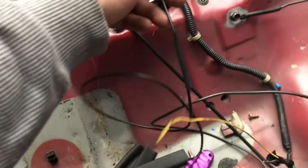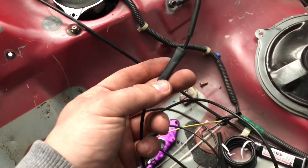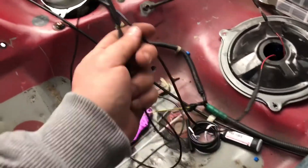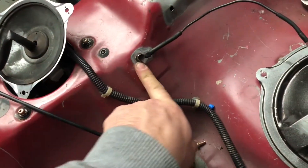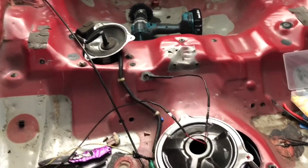For the hot wires with constant voltage, I'm connecting them with quick connects and then putting a little heat shrink over the top — not fully shrunk down — so if something happens with the relay or pump we can disconnect easily without re-soldering. I did the ends but the connection is still solid and removable. Do that on all connections that have power. The ground connection doesn't need it since it's always fully grounded and won't cause harm if it touches elsewhere. Thanks guys — drop a comment below, hit the like button, and subscribe!